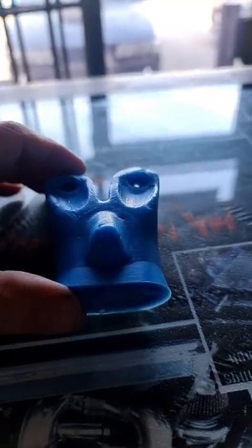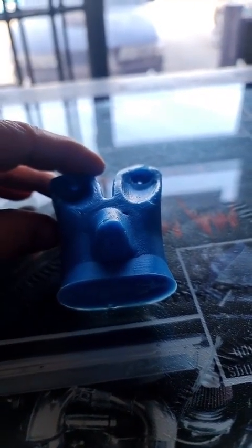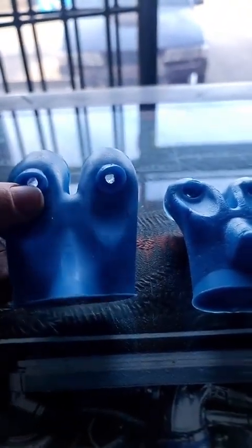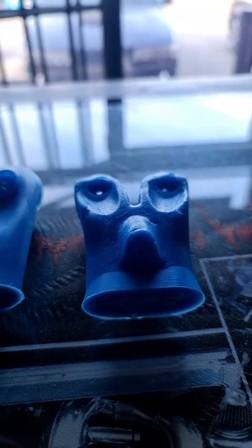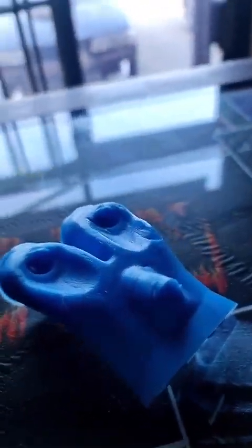The moulds make it really easy and I like to keep a factory mould - this is what we'd do any time we were developing a head. I haven't done one of these in probably a year or so, so I thought I'd mould it up to show you guys a few of the problem areas and the difference that 20 years can make. As you can see, that's the Honda versus the 4AGE. Cast quality - you can see it's very grainy, where the Honda mould is very very smooth for a casting. The castings have improved - this 4AGE is from around '86-'88, and the Honda I think is from 2002-2006.